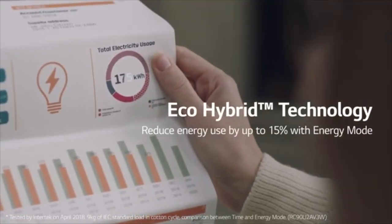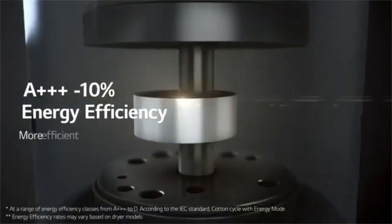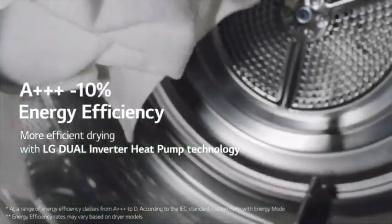Energy saving is the main benefit. Your electric dryer is one of your home's most costly appliances — a traditional electric dryer is the equivalent of a giant hair dryer. With the cost of electricity these days, a heat pump will save you considerably. This heat pump only uses 5 amps versus 30 for a regular dryer.